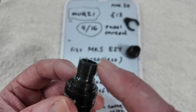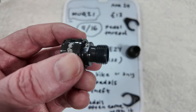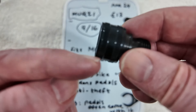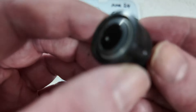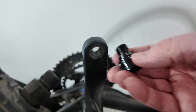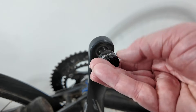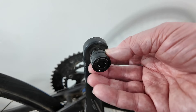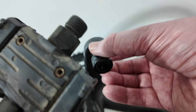For most people on adult bikes, 9/16th of an inch is the size of this pedal fitting — 20 threads per inch. That's pretty standard on bikes. So it fits this side okay. I've got a left now — tighten anti-clockwise. So that fits fine, but it doesn't fit my threaded pedal.